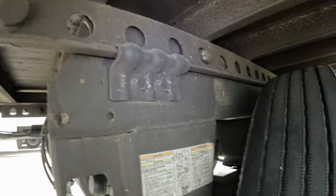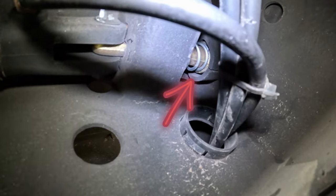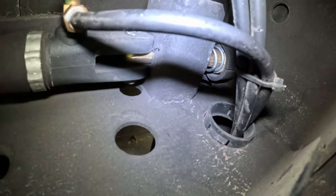Just in case some of the pins are not locking, you can check the pin itself here — you can see it has a spring. If the spring is missing or broken, you have to have that pin replaced.